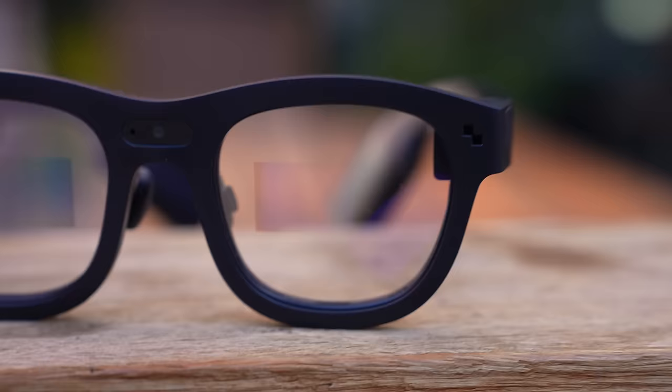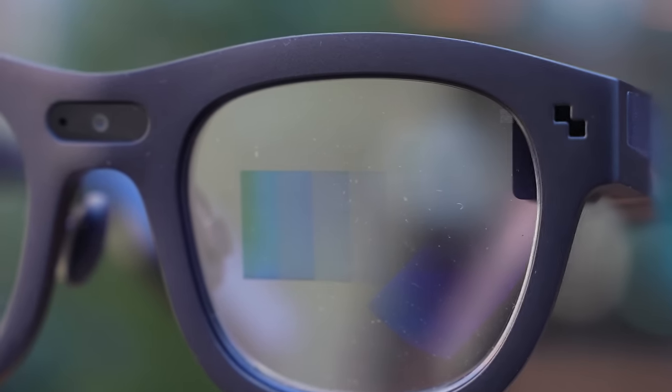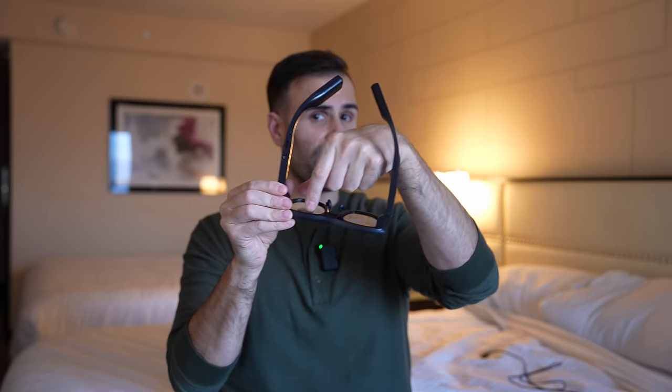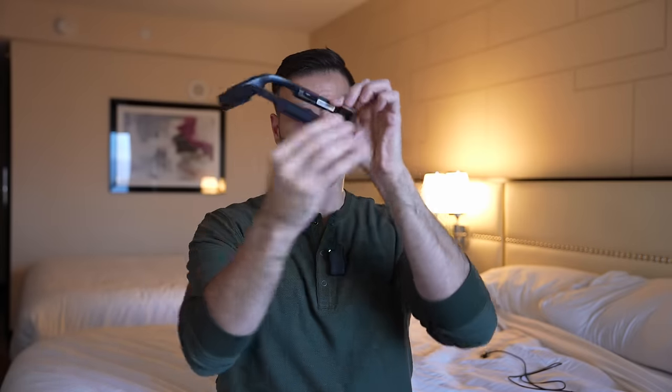The cool thing about it is it looks a lot like a regular pair of glasses. They're obviously thicker and bigger just because there's a compute element inside — these are using a Qualcomm Snapdragon XR2, which is a pretty powerful chip. One thing that's very different is the lens setup: these are micro LED lenses, so you get really crispy images, but without a thick layer in front that gets in the way. These are like your traditional lenses, but with a display embedded in them. The advantage is that you don't have to adjust the IPD — once you put these on for the very first time, they're ready to go because the displays on each lens are wide enough to support different eye sizes.